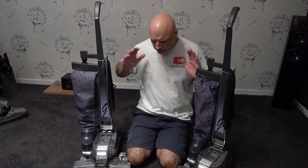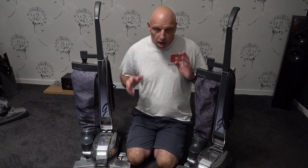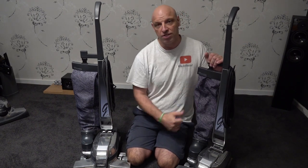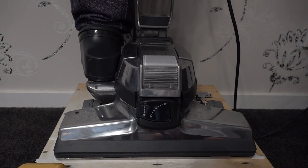For this test, we're going to run a CFM test — and we're doing a Sand Test in the following video — just to see what difference it actually makes and if it affected the agitation. I'm assuming it did lower it down. Today we'll just run the CFM test: we'll see what the CFM is on the original G4 with the 700-watt motor and 3 amps, and compare it to the G4 dropped to 635 watts and 2.8 amps.